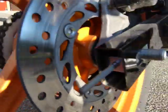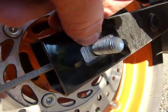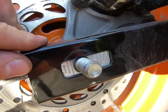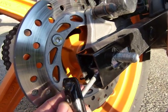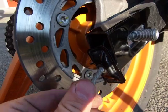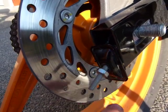What you have here for the adjustment mechanism works like this: this adjustment mechanism is pulling the rear axle back in the swing arm. You have a play of about plus or minus 12 millimeters or so. The adjustment is done using these little adjustment bolts — one of them is a 12 millimeter, and the counter nut is also a 12 millimeter counter nut. But basically this bolt does the work, though you kind of need both, so make sure you don't lose any of them.